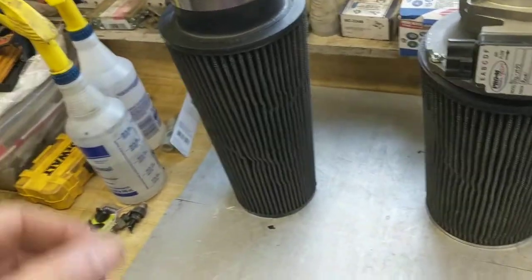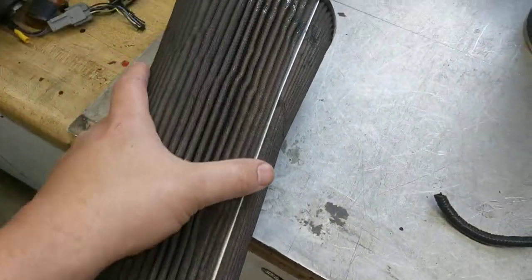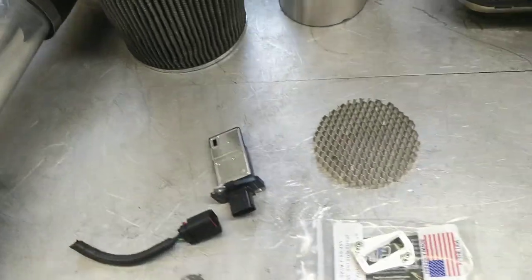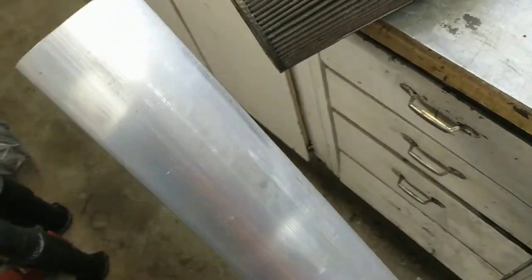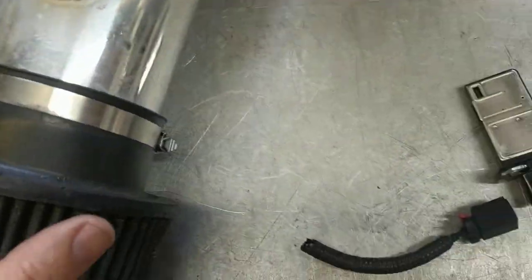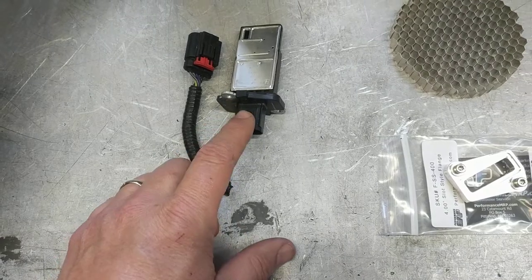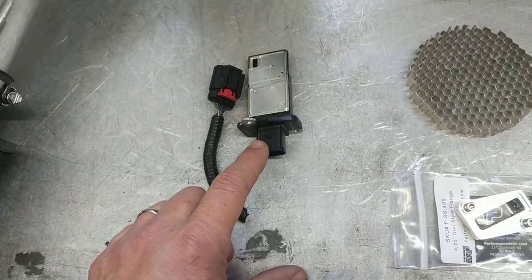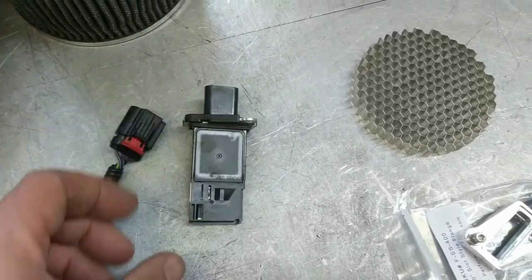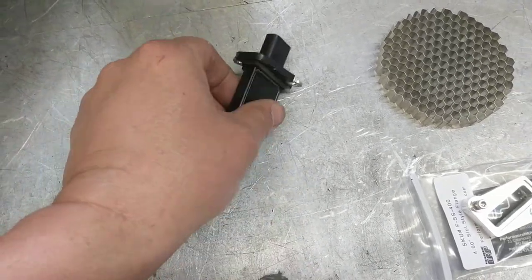My second favorite is the slot meter. This is the one I had on the stupper trooper. It had a big 12-inch conical air filter with a piece of aluminized tubing — I get that through a place I think is called Airflow; I'll put a link up. You can buy different lengths; this is like a three-foot length of four-inch aluminized tubing, 102 millimeter. That works really good with a slot meter. You can get the slot meter connector from a junkyard — I think 2006 Mustangs and up use them, the Ford Focus, the Edge, any of those Fords all use the same one.